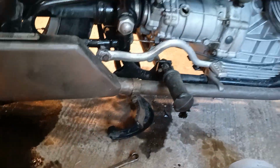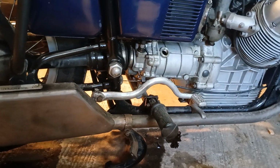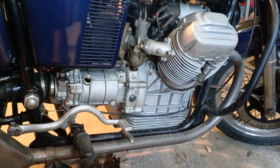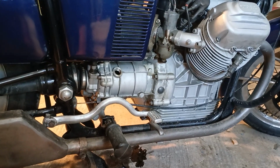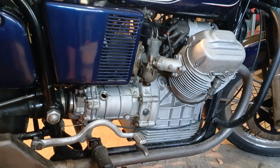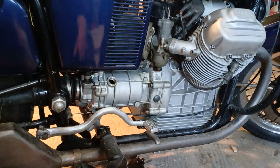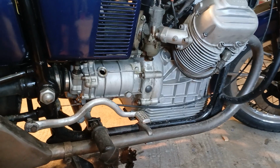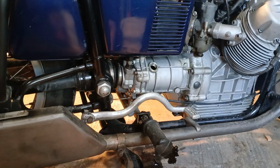and we'll run the bike for 1,000 miles. Well, the engine, I'm changing the oil every 1,000. Guzzi say every 1,800. And although I might do that on a trip, while I'm around home, I'll change it every 1,000. It's not that expensive. It's about $10 to $12 a litre. So, you know, there's no oil filter on it, which is why you have to change it so often. So, you know, 35 bucks, 36 bucks, even 40 bucks is not expensive maintenance. So there we go.